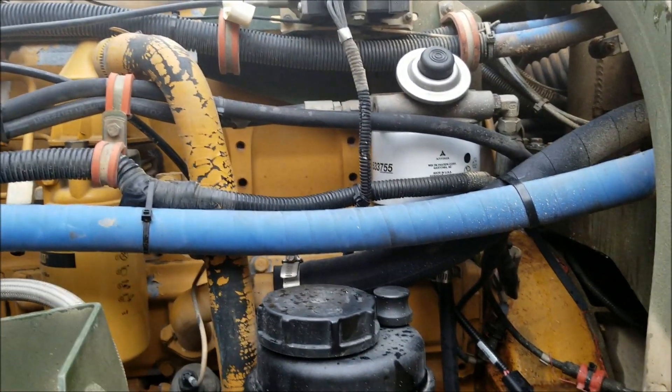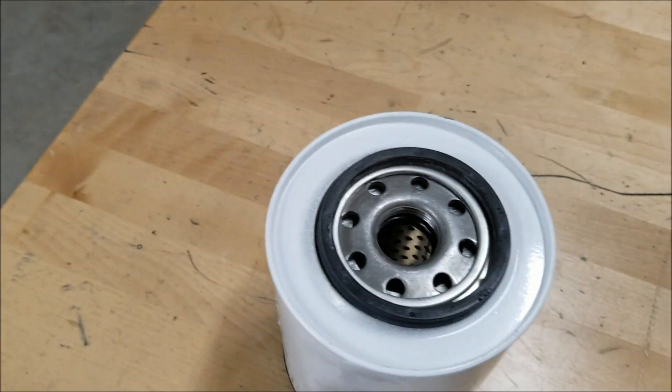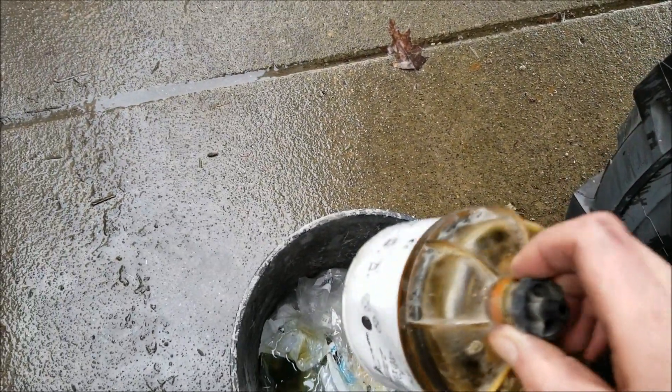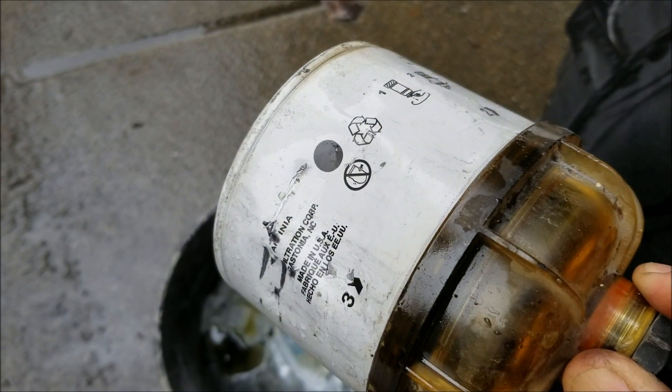I put a brand new filter on there. The filter that came with the MRAP doesn't fit — I'll show you why. Look at this filter — it has a gasket on the inside like that, and here's the housing. The original filter that goes on the LMTV with the priming pump has a much larger gasket. So the threads work, it's just the gasket doesn't seat — there's nothing to seat it on. The reason I wanted to get rid of the old one is because it was trashed — the threads are screwed up on the drain valve. It was time to change it out anyway.